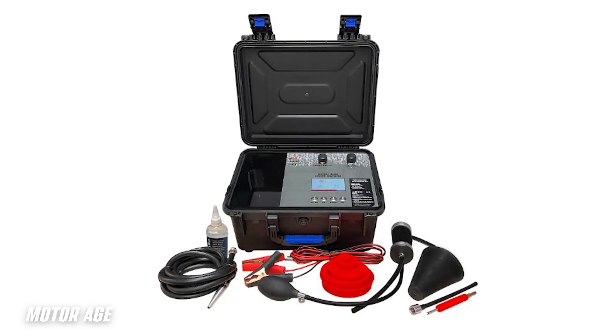Having access to a tool like the pressurized smoke machine makes the job far easier. When a tool like the Mastercool 43066 Digital Dual Smoke Machine is used properly and logically, streamlined diagnostics is possible. Completing an analytical test drive while gathering appropriate data allows a technician to first decide which direction to head in — whether a leak is present, and under what conditions it appears in the scan data. Utilizing that information for pinpointed testing using component isolation, we were able to easily locate a leak on the cold side of the pressurized induction system by introducing pressurized smoke.